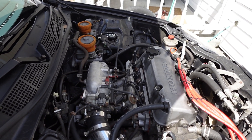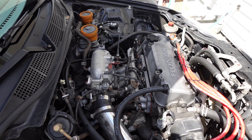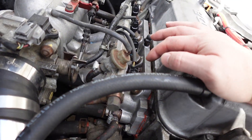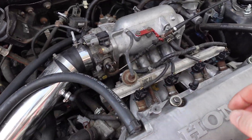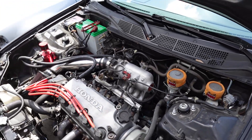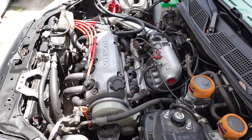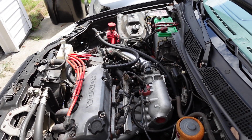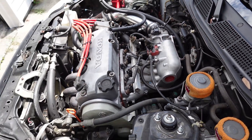Comment your questions and refer back to some of the other videos when I was discussing IACV running issues when it was turbo. Let me know what you're having problems with and I'll follow up with another video. Your bolts are all pretty easy to get to — you should definitely torque those to the correct torque spec. All bolts are very visible except the one right down here on the bottom of the intake. I torqued all of them, but the center bottom one I did by feel. If you're not comfortable with that, come up from underneath near the oil filter with some adapters, swivels, and link sockets to get a torque wrench on it.